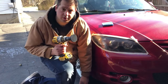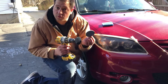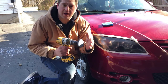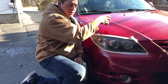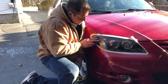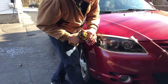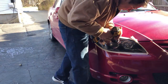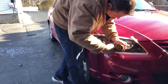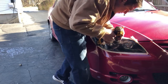With 800 grit complete, take that off and switch to 3000 grit — you only have one per lens. You'll know this one because there's a thin foam padding on it. Get a sponge moistened with some water, put it on the lens, and go over it the same way as before. You'll actually see some imperfections come off — this is a great way to fine-tune everything and make sure you've got all your scratches out.